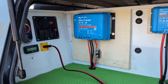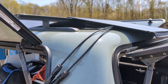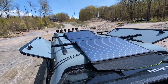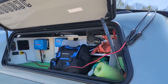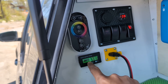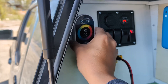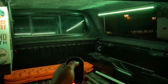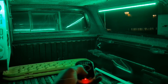The panel is hooked up just with this outlet plug here — you can see the wire going up and over to the panel just laying on the roof. This is the All-Powers 200-watt mobile solar panel foldable unit, and this is the first time hooking it up and I'm pretty impressed. To the left I have the battery capacity monitor, which also has a voltage reader to see what percentage the battery is at. I also have some house lighting installed from the previous video, all run off a switch remote — some atmospheric lights for the truck that are really nice at night.